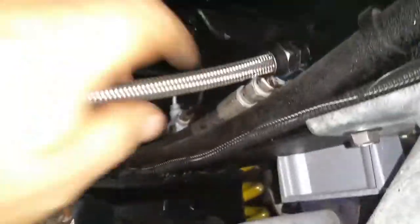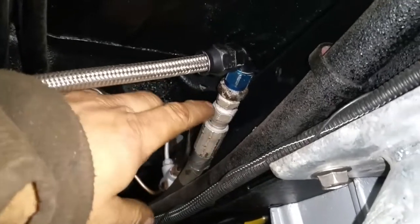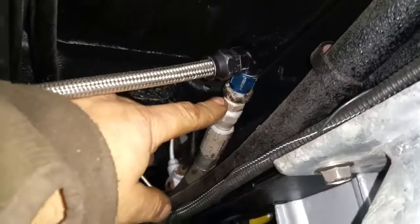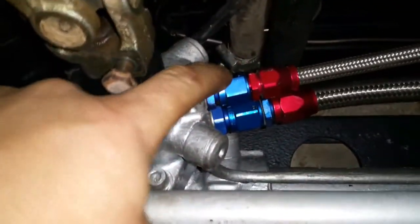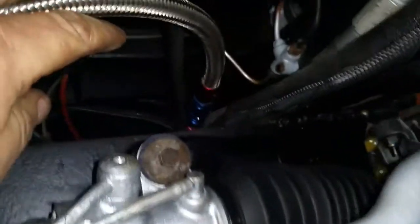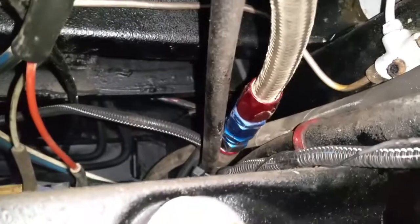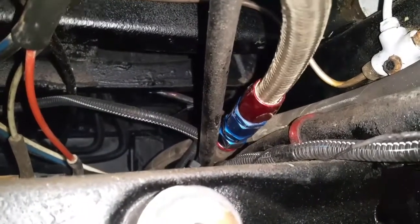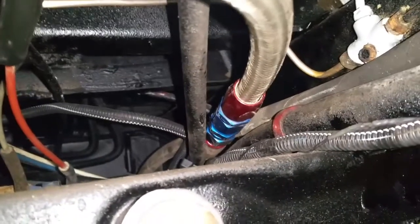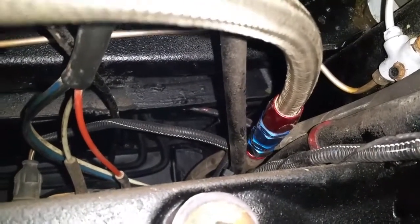The pressure line is a little bit longer, so that one is attached to a brazed-on fitting I did some time ago so it would take an AN fitting — AN6 in this case, as it's the pressure line — going through to the input of the rack. The return is a dash-8 (AN8) because it's slightly wider in bore, and that joins up to the original hose with a push-fit fitting. Those push-fit fittings give a lovely transition from normal hose to an AN fitting and they're tough and take a lot of pressure — though there's hardly any pressure on the return line anyway.